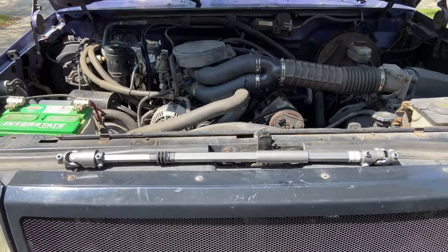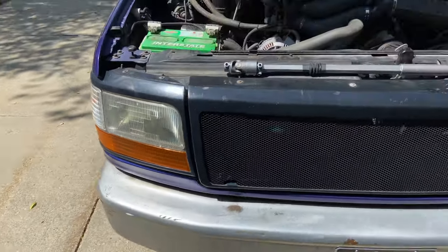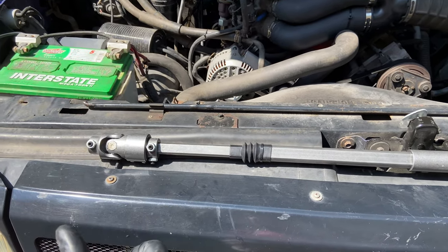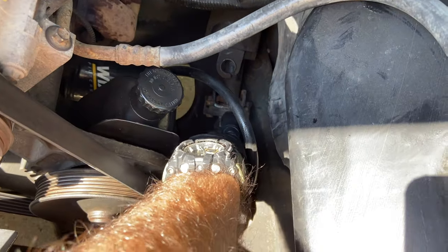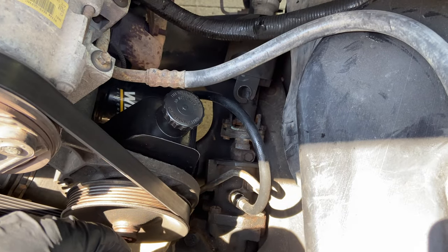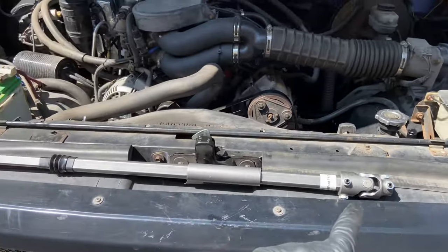If you own one of these old vehicles, you've probably noticed the steering has a lot of extra slop in it. There are any number of reasons why, but if you've gone through most of your lower suspension pieces, you'll probably come to this final piece: your steering shaft. It's an improvement because it has zero miles on it so the joints are fresh, and it eliminates the rag joint — a rubber piece meant to reduce vibration but which also allows a lot of extra wiggle room. At 230,000 miles it's probably extra gummy.